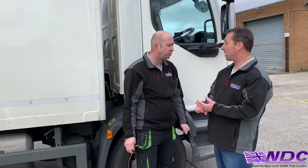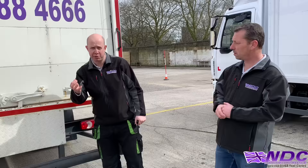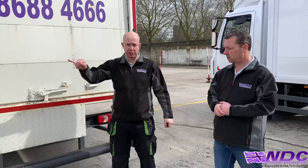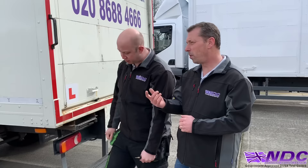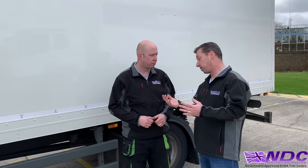Walk around checking cargo doors — make sure padlocks are fitted with keys in your possession. When parking at night, back up to either a wall or another vehicle. At the rear, ensure back doors are locked and anti-tamper devices are fitted, especially if loaded at a depot. On curtain-sided vehicles, make sure the metal seal goes around the vehicle and is padlocked accordingly. Don't pick up hitchhikers, don't discuss your load in public, and vary your routes so you don't become a creature of habit.